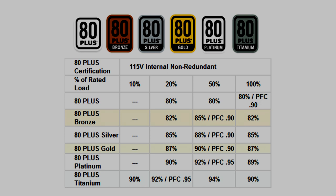Here's a graph that explains exactly how that works. When it comes to 80 Plus certification, there are a couple of misconceptions. First, if a power supply doesn't have 80 Plus certification, does that mean it's horrible? It does not. In fact, there are several power supplies that are not 80 Plus certified but actually give you typically about 80 to 85% efficiency. One example is our 400 to 500 watt picks this month — the Antec VP450, which does not have 80 Plus certification but has typically 80 to 85% efficiency. It doesn't have a PFC circuit, so it cannot be 80 Plus certified.